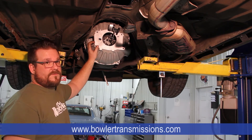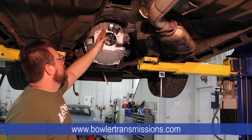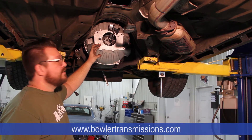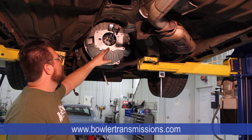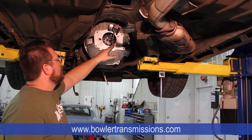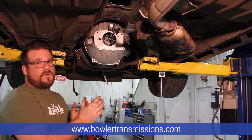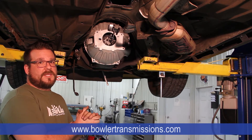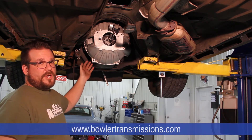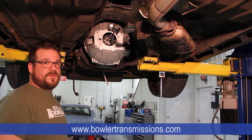Like with our flywheel, we're going to start at the 12 o'clock location, make a couple sweeps around to check for consistency in our dial indicator mounting for repeatability. Then check for any low spots and high spots in this area on the mounting flange. Total indicator runout for bell housing parallel alignment — you want to be at two thousandths or less. If it is more than that, you'll likely have to shim the bell housing at some location to get that reading into the two thousandths range.